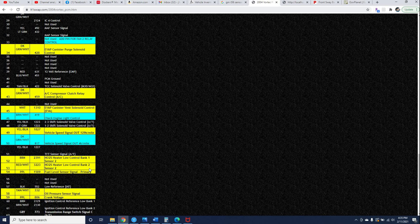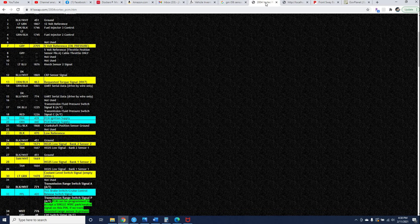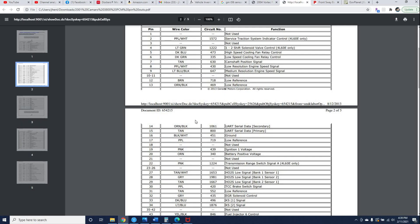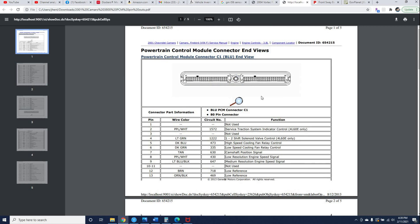I went through the entire harness I pulled from the V6 Camaro and matched up all of the pins using that same process. I had some wires I wasn't going to need, some that needed to move to a different location in the connector, one or two that needed to move into the other connector, and some that could be eliminated altogether. The Envoy pinout list I found at lt1swap.com — there's a ton of good information there. The Camaro harness pinout I found through a Camaro forum. These cars are old enough that you can find all this information readily available on the internet — just use whatever search engine you prefer.